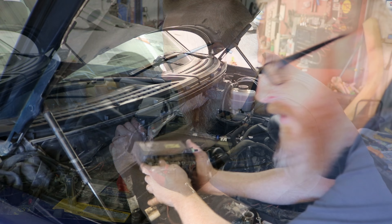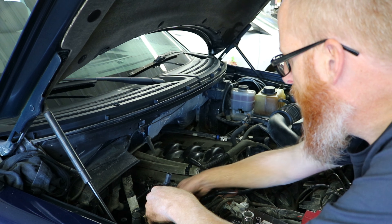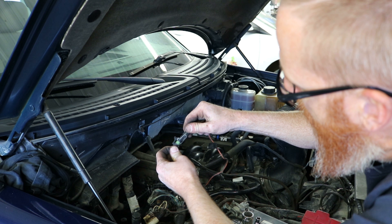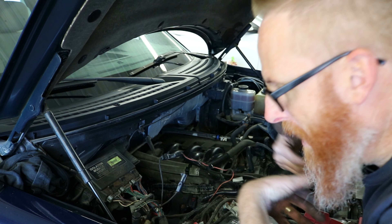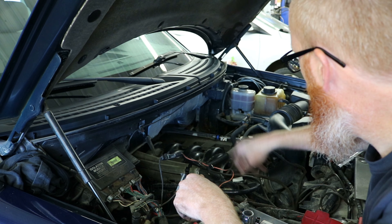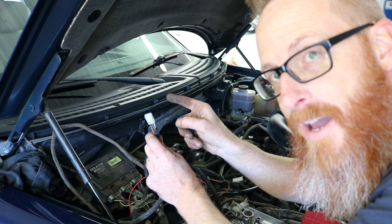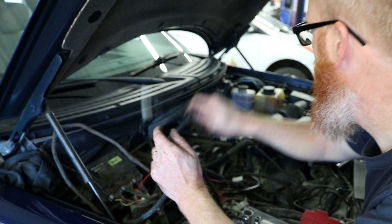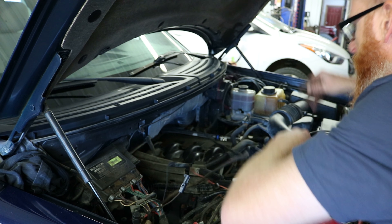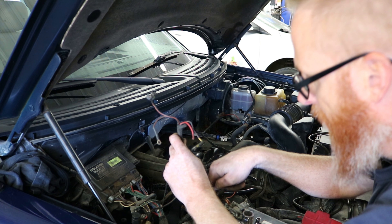We're going to put some dielectric grease on the ends of those terminals to help keep everything out, and then go over and do the same thing on the other side. We've got the headlights all back in — everything is plugged in, all weather tight, so we don't worry about any corrosion. Right now we have the isolation module — it's three port, everything is plugged in. I've got a ground wire that plugs in right here that grounds out the isolation box. Everything is plugged in from here back as far as the controls of the plow. Now we have to get this plug-in run inside the cab because the little joystick that controls up and down, left and right, plugs into this.